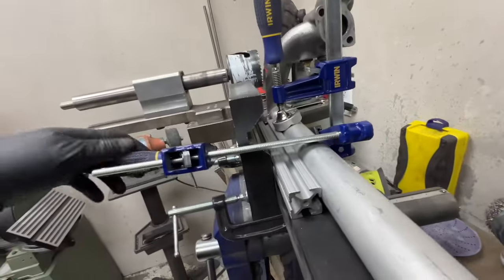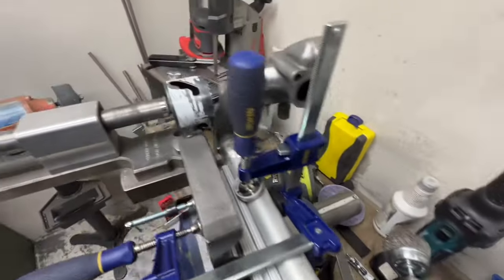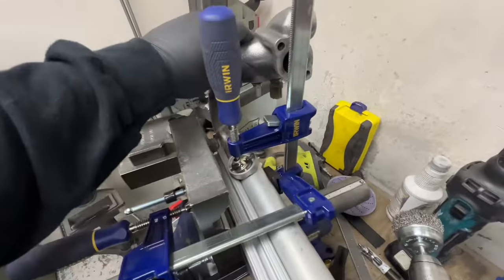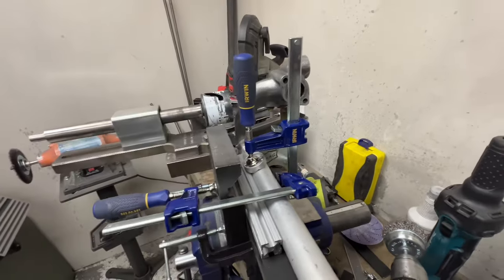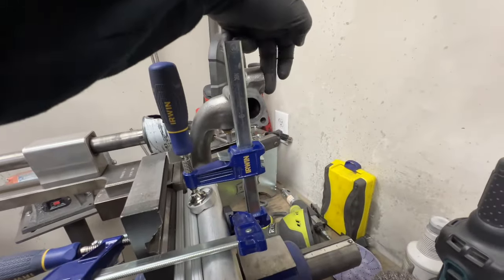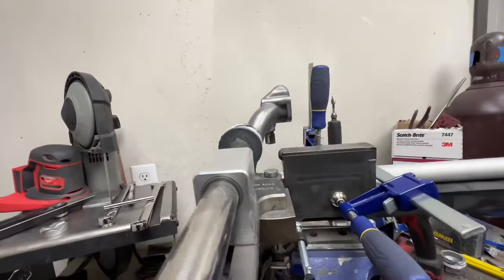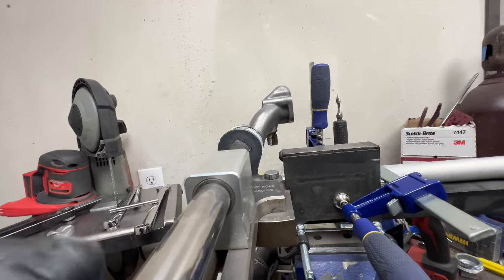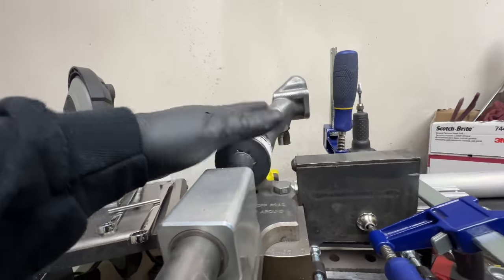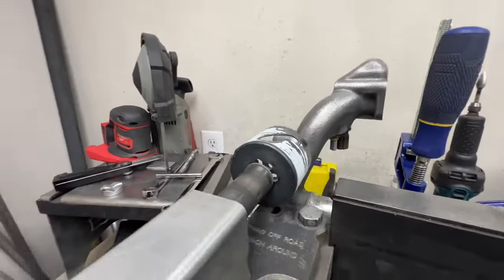And then I had to use these clamps to clamp the tubing that's tack welded in four spots to the water neck. It feels pretty sturdy right now. The whole unit moves as an assembly. I zeroed an angle finder off of this, made sure this is within a degree. It's pretty hard to get that perfect. But the plan is to notch it right through there with my 2.5-inch hole saw, so it's perfectly coped for the 2.5-inch aluminum tube. So let's start cutting through this thing, see if it doesn't get too wild.